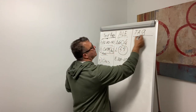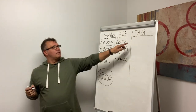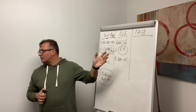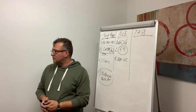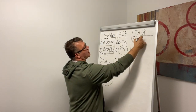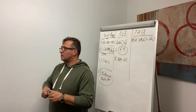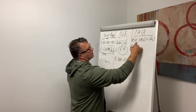But there is something that we need to do for preparation. First thing we do, build up pressure. What's preventing us from driving now, what doesn't let us go? If we don't build up the pressure and we didn't release the brakes, we'll be blocked. That's number one. So build up pressure until it cuts out between 120 and 140, right? That's number one. What else doesn't let us go? What do you think? Chocks. Second, you need to release chocks.